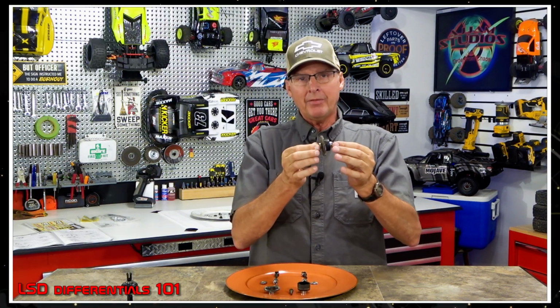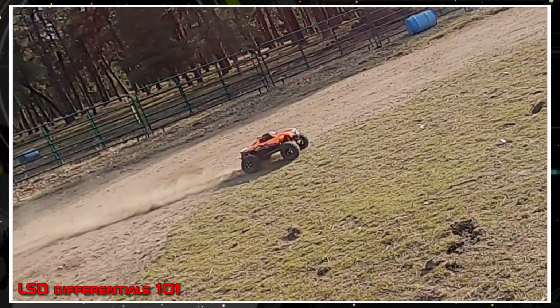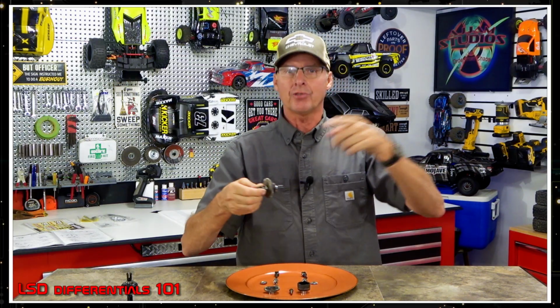Okay, when the weight's above the tire, that's the body and all the stuff there, it inherently leans back. That's only part of the reason it crouches. The other part of the reason is called counter rotation, and that's where the motor drives the tires and wheels, and the bigger the tires and wheels, the more the counter rotation against the chassis, which makes the front end lift because it's driving the tires forward. The counter rotation drives the chassis the other way and it tries to lift the RC. That applies to everything. That's just physics. That's the way that works.